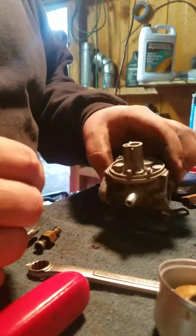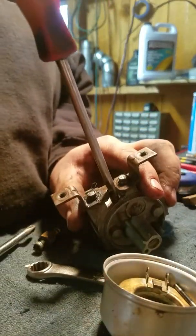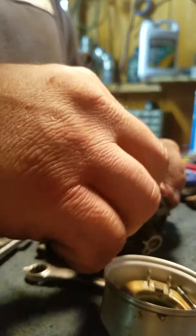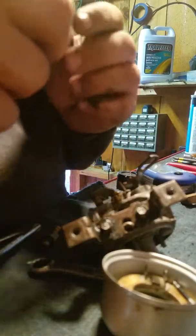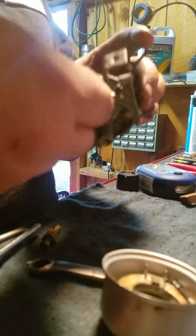I'll show you how to reassemble it. Make sure you line the bowl up. Oh, I forgot to take this jet out — this is your idle jet, or idle screw, whatever you want to call it. Take it out, check it out. It's got a little bit of stuff on it, nothing much. If you get that surging when it's idling, you should be able to adjust this one — if the carburetor is cleaned right — to fix that problem. Just turn it in, turn it out a couple turns until it stops surging. Also, when you spray carb cleaner down on the inside where the shaft goes in, it can get gunked up with gas and the thing won't move. Just spray in there with carb cleaner and it'll free right up.